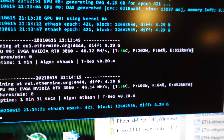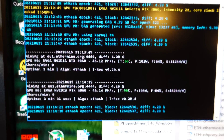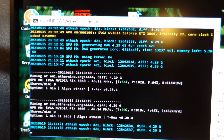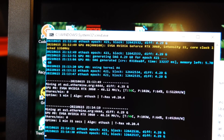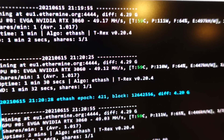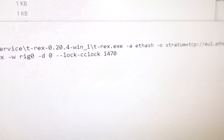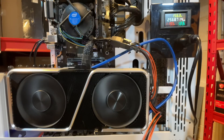After a minute or two it came down too much — 46 megahash at 103 watts. So I made adjustments, going up to a lock core clock of 1470, which gave the best results: about 49 megahash at 110–111 watts, shaving off 5 watts. This is an example of tinkering you might need to do for your specific GPU — that's why there's a range given for where to land your core clock.